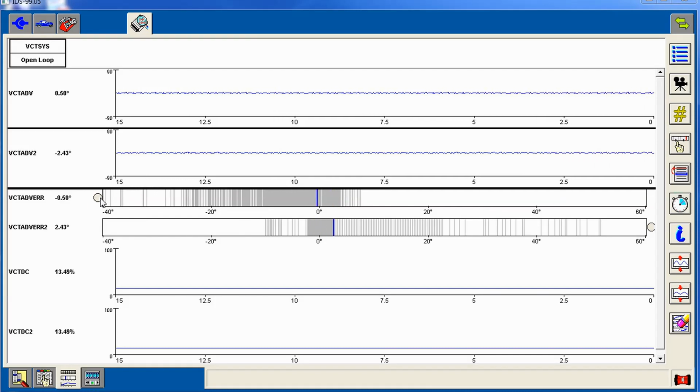At base RPM we're stopped, the thing's just trying to die out and rattling and everything else. All the timing is off. So all the combustion and the fuel timing and the spark timing, everything's messed up because of the actual cam timing. So it's very, very obvious here. And over here, this other one, it's not so bad on bank 2, but this has got 171,000 miles on it. So it's kind of doing the same thing over here.